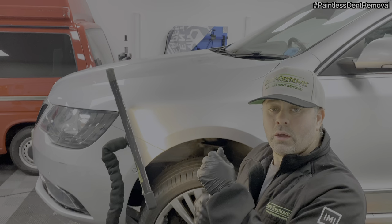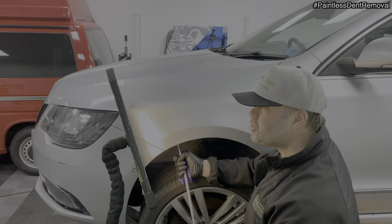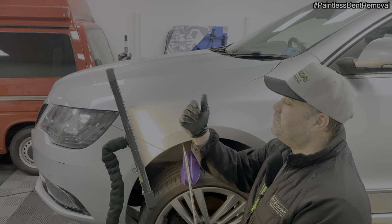Back in again with another plastic bullet tip. I'm just going to use a hand support as well. So this goes on the tyre like that, and then you can lever off it. It just saves the hand from being crushed from the force of the bar when you're pushing against the tyre. Your hand is usually in the middle. That's what gets all the pressure and breaks your bones. Right. Don't make them look pretty anyway.